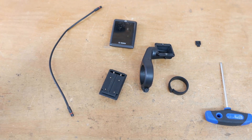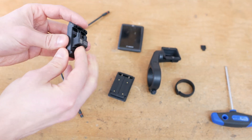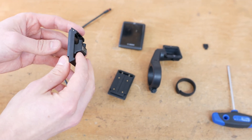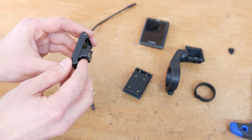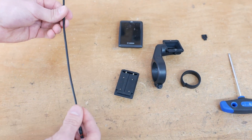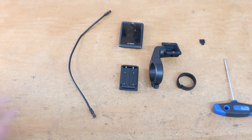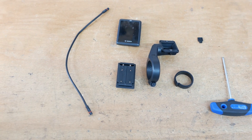and the other connection aimed forward. This is crucial for the way and the place where you intend to mount the Kiox 300. You need also a shorter display cable to connect the display with the LED remote. The cable is available in our shop — you can choose the length that best suits your handlebar, also depending on where you prefer to position your display, from 10cm to 2m.